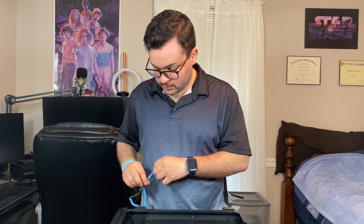Now we can disconnect ourselves since we're not going to be touching anything in the CPU for right now. It's worth mentioning that I'm not going to be using the CPU thermal paste that's on the CPU cooler. I'm going to be scraping it off or using alcohol on a cotton swab, wiping it off. I'm going to be using this instead — I've heard the thermals with stock thermal paste aren't the greatest. I used this on my iMac to install the i7 from the i5, and it works really well. It does support AMD. And if the thermals are bad, I'll get a more high-quality thermal paste and replace it.